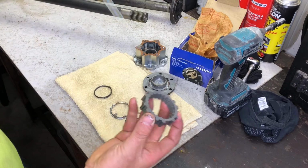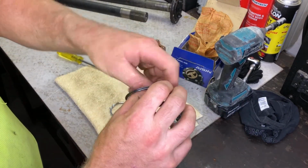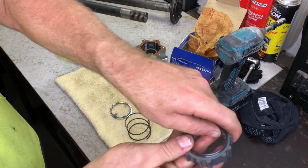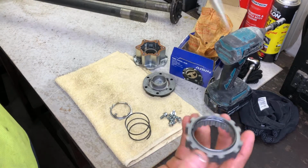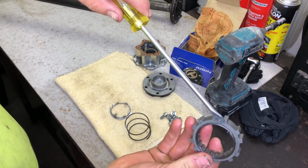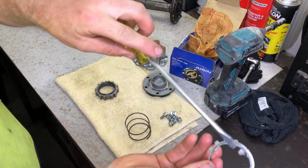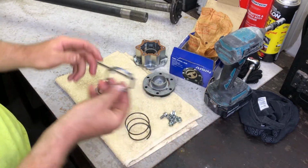Starting with the clutch, you can see a groove around the inside and an opening between the splines. Insert your small spring into the groove, then line up the end of it with the last spline before the gap. The other end of the small spring has a bend. This must be located against one of the larger inside tabs of the pawl, with one of the smaller outside tabs locked in between the splines on the outside of the clutch.